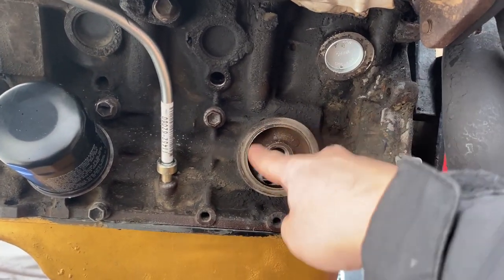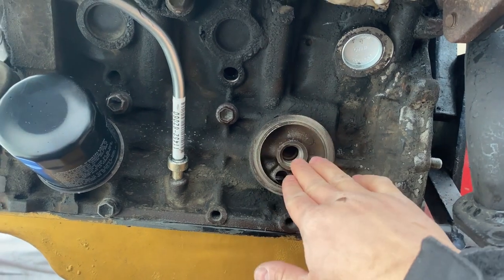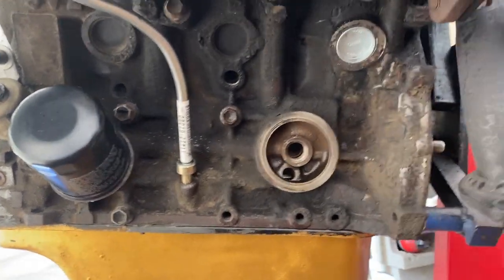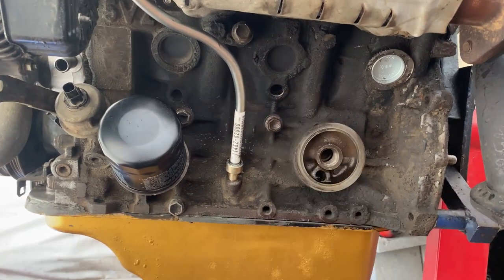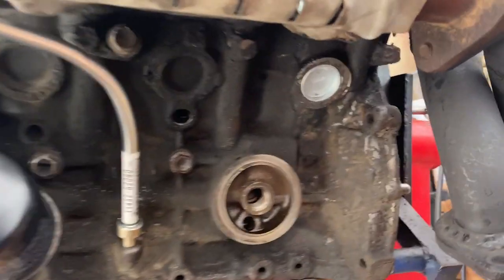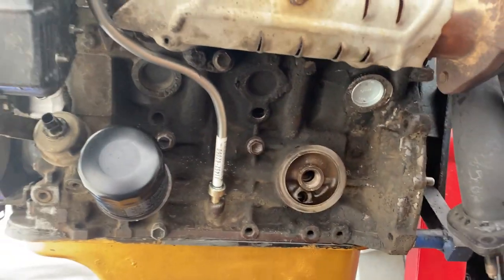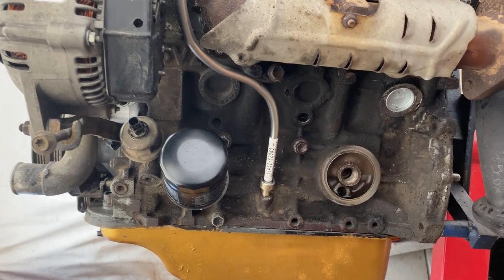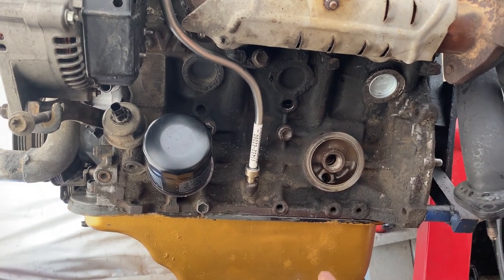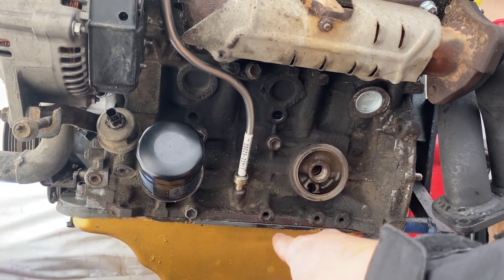My oil cooler is right here, and I've decided to delete it — I ordered the kit that blocks off the oil cooler port and also blocks off the water pump connection. I want to make this engine super clean. I also replaced the union here since it was a bit dinged up. Quick recap: the dipstick kit from Toy Only Swap runs about $60; we're using the 3.0 pan, the 3.0 pickup tube with one leg chopped off, direct-fit installation, and the 3.4 baffle is still in use.